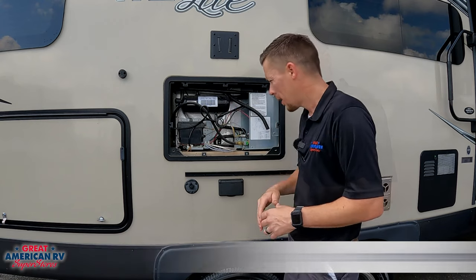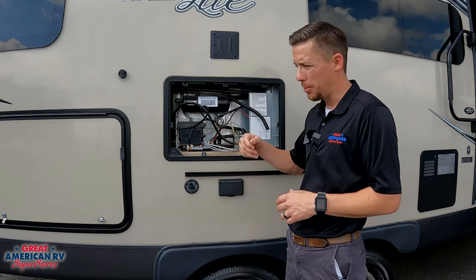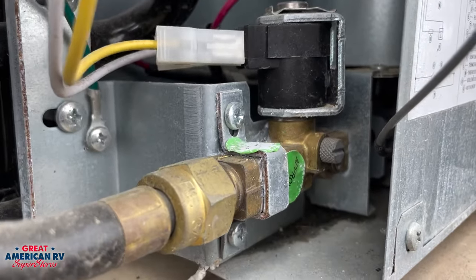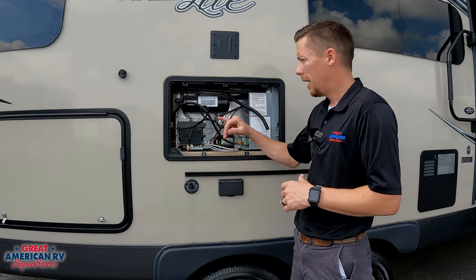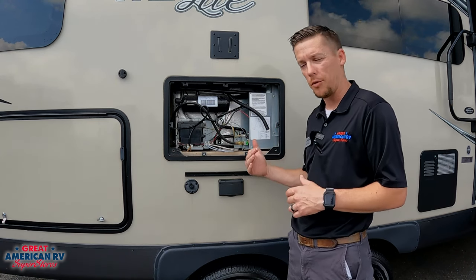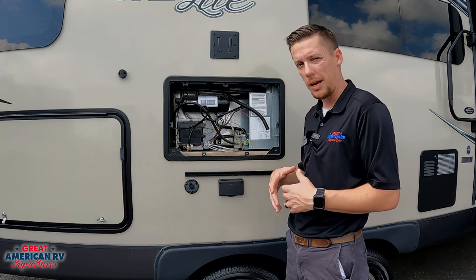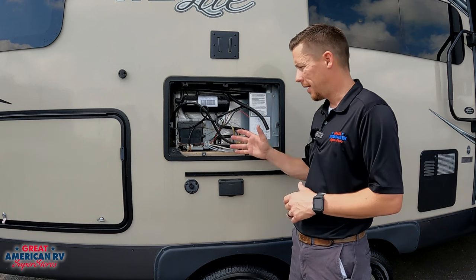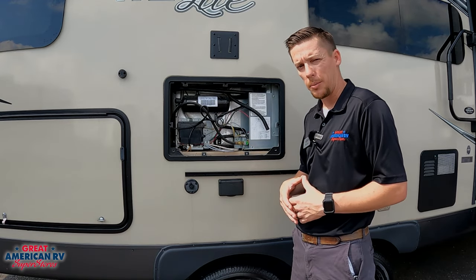It gets very, very hot back here. The main thing to concentrate on after you've initiated propane or unplugged from shore power is coming back here and listening for a ticking sound — that's your igniter trying to ignite the propane. If there's air in the line, there's a tiny hole and it'll take a long time to purge, which is why you bleed the stove out first. The system will try about three times before it quits and gives you a check light. If it doesn't actually try to ignite when you unplug, go ahead and call our service center to set up an appointment. And don't forget, when putting the cover back on, feed your drain tube right through that hole.